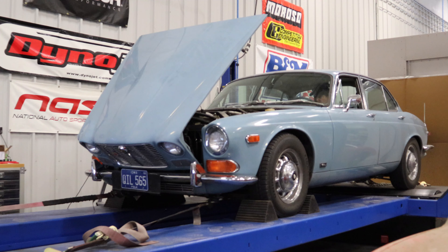Here is where I'm hoping that I'll get a big difference. These are very good, high-quality leads here. As you can see, my old ones are just brittle and broken — the mice have gotten to them and chewed on them — so I'm hoping this one is going to make a big difference. One thing to note when doing this and checking your firing order: Jaguar labels the cylinders backwards. Cylinder six is actually in the front of the car, and cylinder one is the one in the rear of the engine. I have all the new high-tension leads fitted.